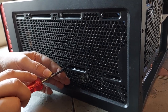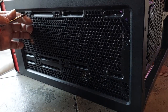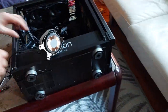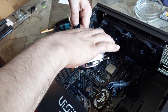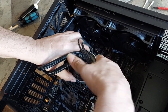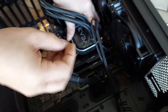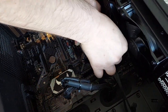The radiator is on. Put the pump in place here — you can see the thermal paste. You can orient the VK logo on the pump head the way that works best inside your tower. For me, it's this way. Tighten these four screws, but don't tighten too much — just put them on snugly.